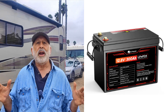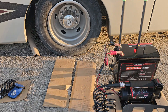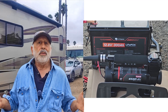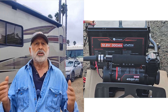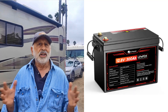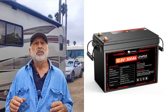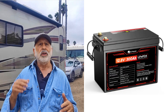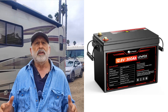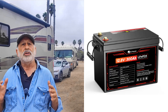A question I've gotten: does anything crash when an air compressor, power tool, heavy-duty appliance, or induction burner runs? The air compressor, big power tools, and induction burners all have a short, sharp startup spike when you start them. It's common, but the battery is rated for 200 amps continuous discharge. Airing up tires and cooking on the induction burner didn't even make the lights flicker or kick the fridge off. I use the right fuse close to the battery to protect the wiring when a surge hits.